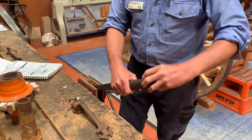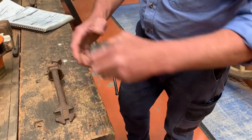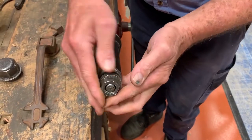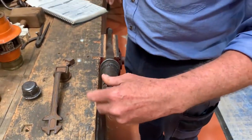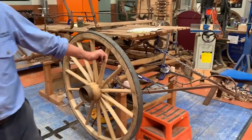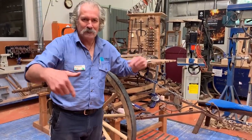This is a sample I've been working on. It has a grease cap and instead of a linchpin we have a nut. Now that's a left-hand threaded nut. The opposite side of the axle has a right-hand nut, so this one goes on the left side of the vehicle and this one on the right side, because the rotation of the wheel has a tendency to tighten the nuts up.